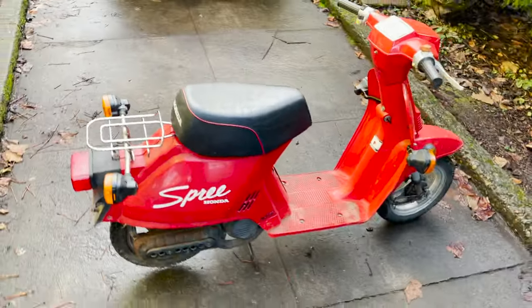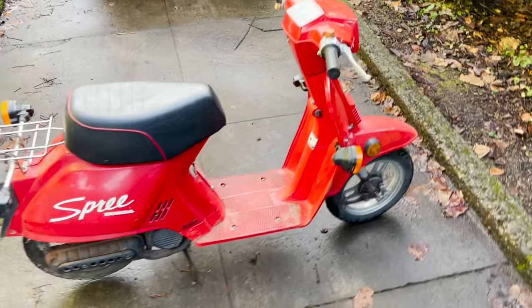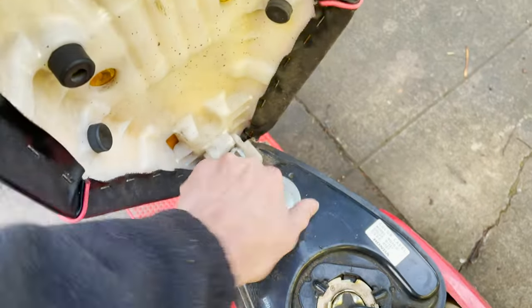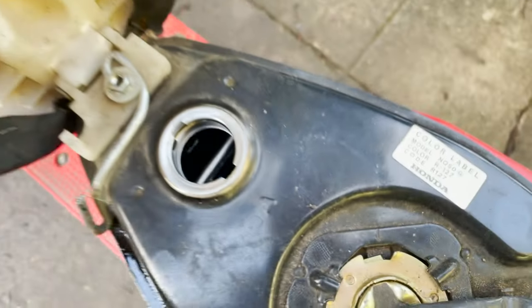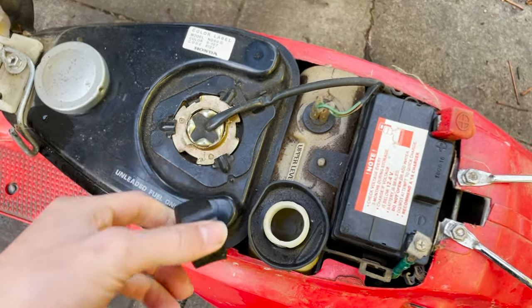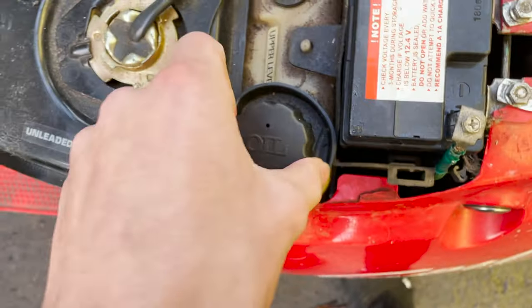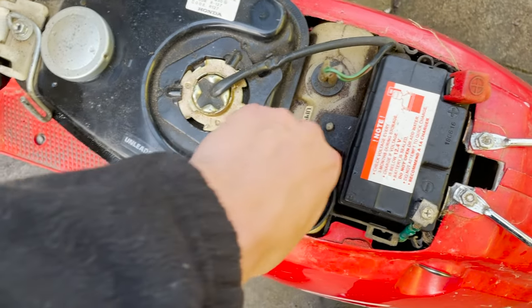But this being a two stroke, I'm not sure if that's even possible, because I think that's only on a four stroke. But let's see if it has any gas in it. Got some gas in it. I'm not sure how clean that is. Supposedly it's a new battery. We can check on that. Ooh, tank is dry. That's the oil tank right there. So that's not good.